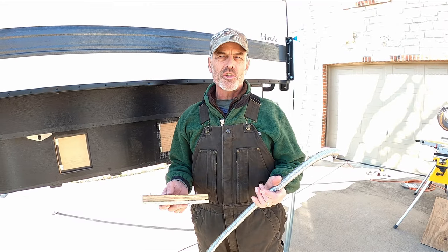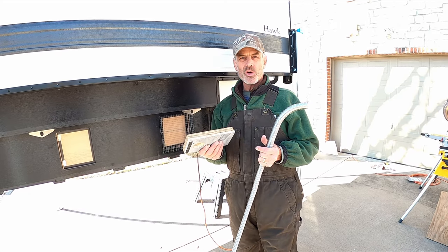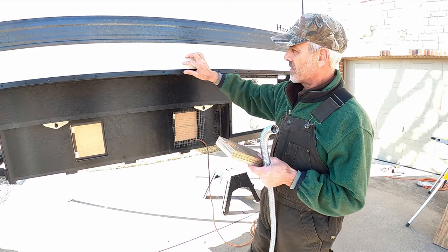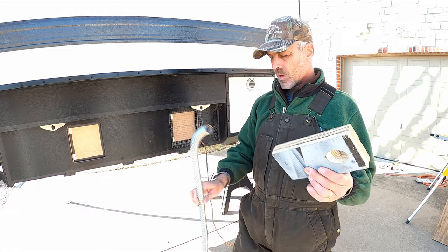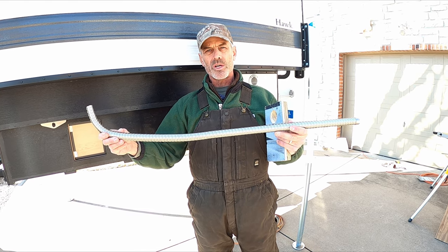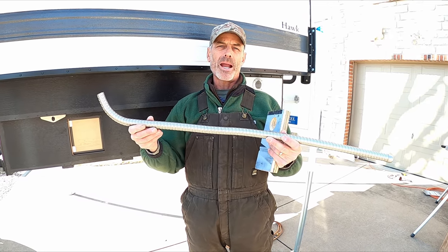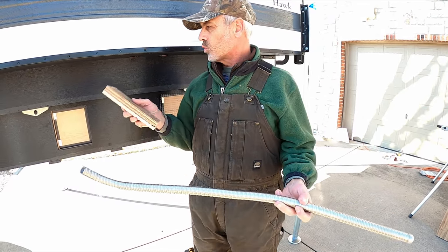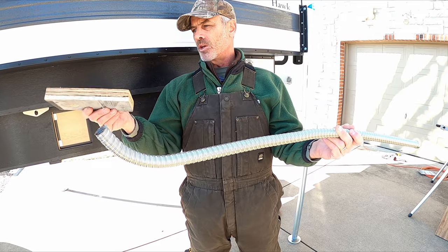This is the scary part of the heater installation where we're actually going to drill some holes into the camper — very concerning for me. So I screwed together a couple pieces of plywood that are the same thickness of what we'll be drilling through. This is the exhaust pipe on the heater, and per the manufacturer's instructions it's not to be shortened — no sharp 90s, can't have a lot of turns, anything that might obstruct it. So I felt that when I drilled through it needed to be at an angle so it could continue that shape as it flowed towards the back of the camper.